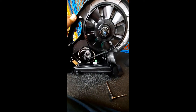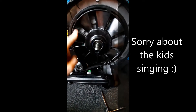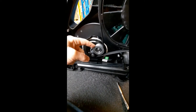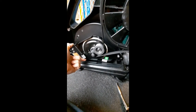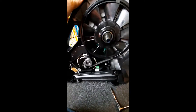Here's the machine — it's pretty simple on the mechanical side. You've got a fan pulley which is an idler and runs on a cast shaft. Then you have the tension idler, which mounts to a tension plate and the tension is applied through a spring. The actual resistance comes from a serpentine pulley on the electric resistance motor, connected to the shaft pulley. And of course the belt itself runs through all of it.